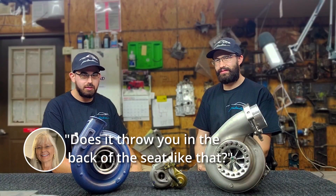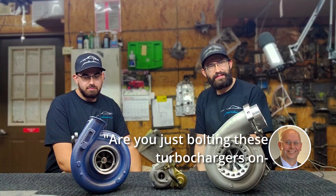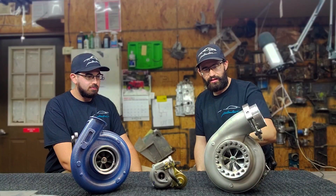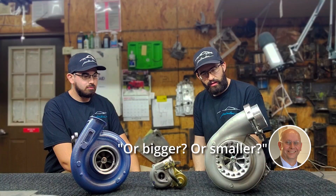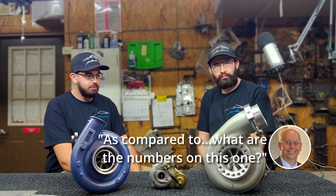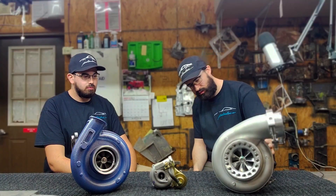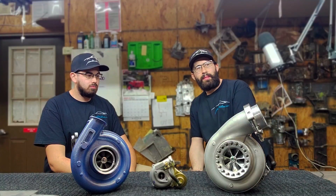So what are you guys planning with these turbochargers — just bolting them on, replacing your stock turbocharger? For compound setup, I'm gonna use the stock HX35 to spool this one, then custom fab all the hot piping and charge pipe. The HX35 is a 58/63 with a 0.89 AR. This bigger turbo is an 83/113 compressor with a 1.1 AR, and the turbine is a T4 divided, somewhere around an 80 to 83mm turbine.